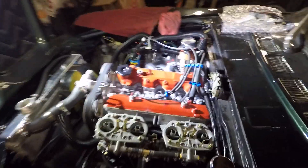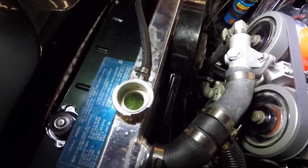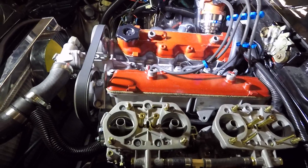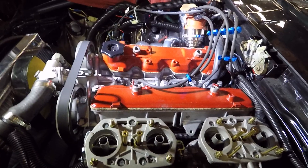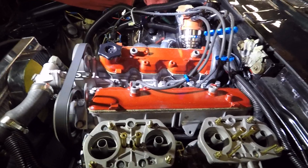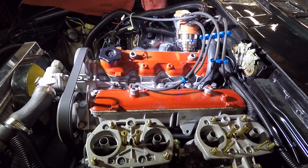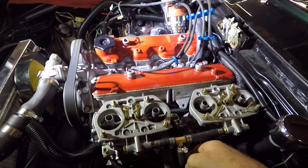As you can see, it starts easily — that 1-2-3 ignition with the 50,000 volt output will fire this off even without cold enrichment on these carburetors. As you can see down in the radiator, the water is circulating immediately with the electric water pump and it'll circulate at a speed to let the engine gradually warm up. With the 285V street cams the idle is slightly lumpy but not objectionable at all. They are definitely street cams and they make gobs of torque in the mid-range, which is what you want on a street engine for fast acceleration at low speed and off the line. Even with a cold engine, the engine response is just excellent. With all the lightweight parts it lets these two liters just rev like crazy.